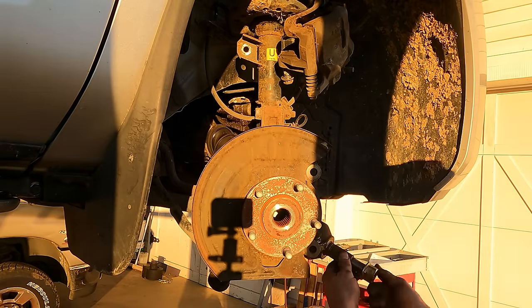Transfer case. So you guys may have noticed all the oil in this area. Well, it's leaking from this. This is the oil cooler. And I did a search and found there's a technical service bulletin on this, a TSB, and there's a gasket in there they want you to replace, and then the gasket against the engine. So two relatively cheap parts. And so I'm gonna do that while I'm here. Stupid not to fix it when it's so easily accessible. Typically that's like impossible to get to.